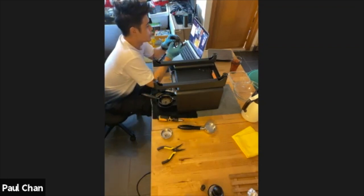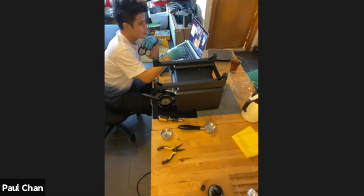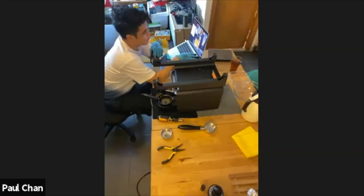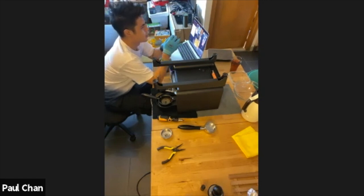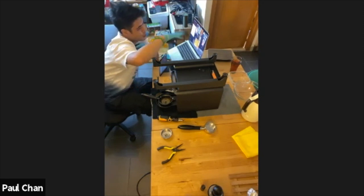So the two main things are the water on the outside, and as I just mentioned, the distance of travel that your group head handle has. So when I flip this over, I'll show you, and I'll also post a photograph that I recently made that I've found very useful for people in having a point of reference. Some people may get confused on when I mean 6 o'clock on the GHC. So essentially, I'm just using the GHC as a clock face, and the extraction button is 6 o'clock.